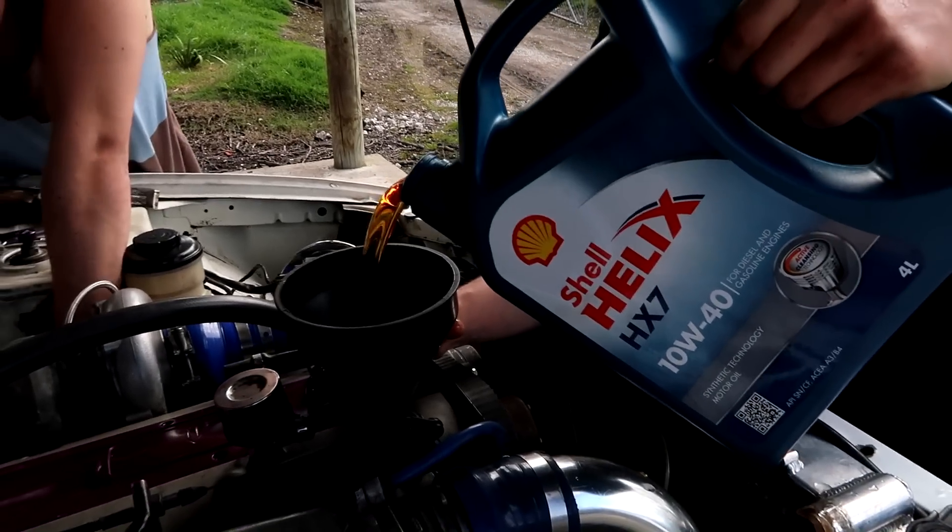What we have here is the fuel pump relay - we're just bridging it off, that'll run the fuel pump constantly so we can drain all the old stuff out, then we'll put fresh 98 in. It's pressurized - bridge it out. It's working - just pouring out all that yuck stuff. Bridge the relay - might need some more containers.